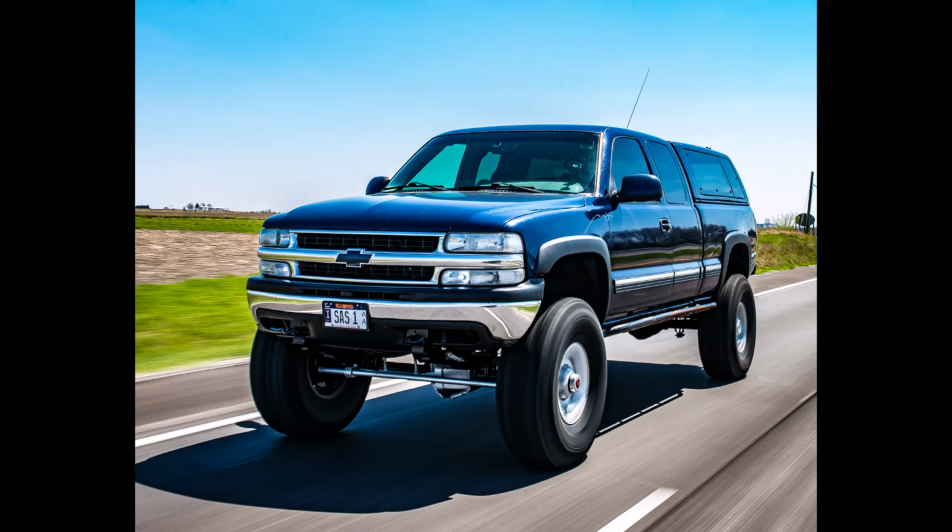Kind of. A lot of it is just that particular obstacle had an undercut. There was a lot of traction. Only one of the front tires was touching the ground. The other one was basically in the air. It was not actually in the air, but it was not doing anything. We were almost getting my truck up, but this comes back to the weight thing. The lighter your rig is, the easier it is on parts, unless you break things. I was watching the tire wrinkle the wall, and I had like 12 or 13 PSI in it, so it was hooking.